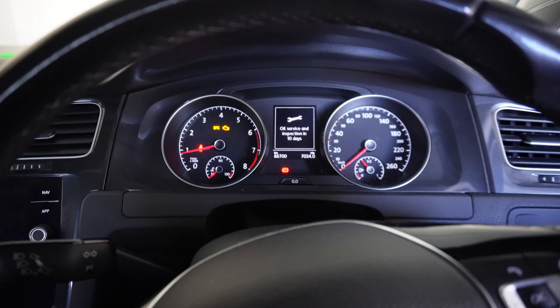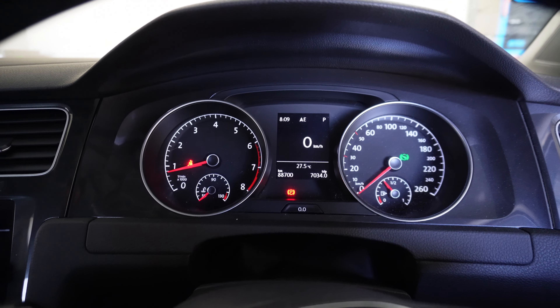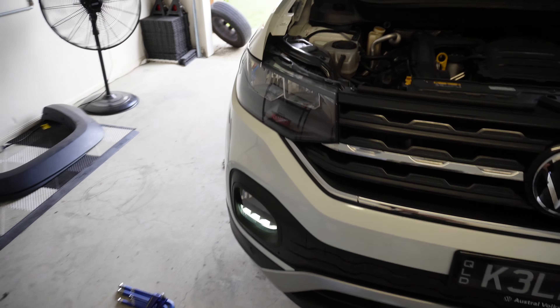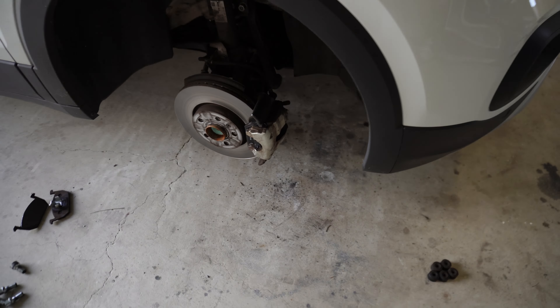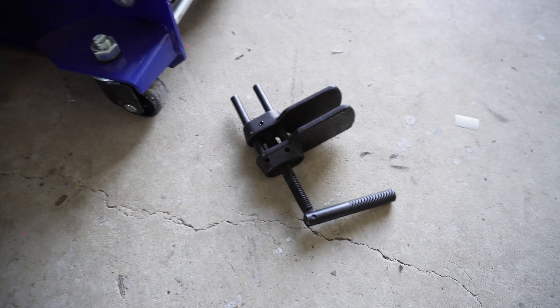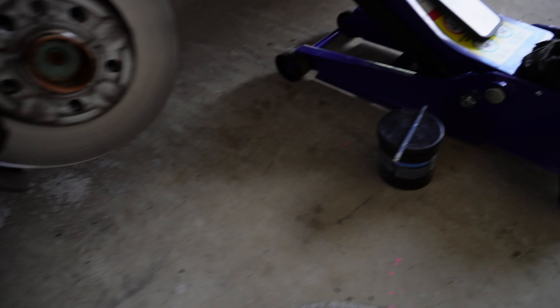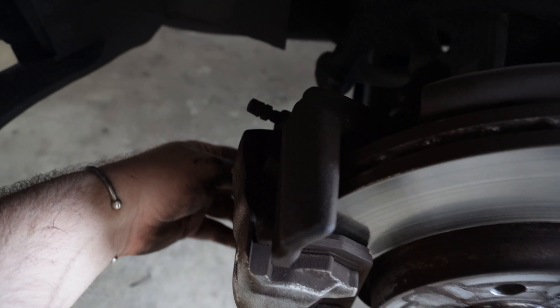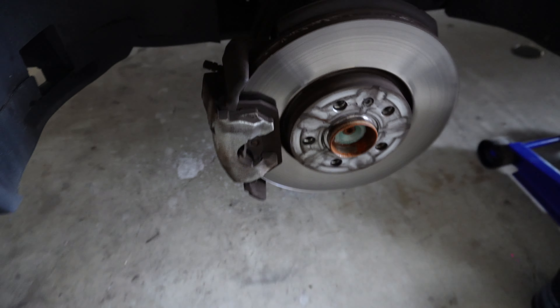Cold start for the boys - she needs a service, 10 business days. We've got a little T-Cross in for some front brake pads. There's the old pads, just about to start on this one. Pretty basic - allen key, piston shrinker, a bit of grease. These little caps hold the caliper - you just remove those allen heads and then the caliper comes off nice and easy.